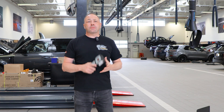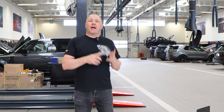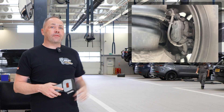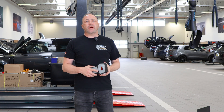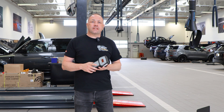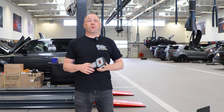So this is to test the park brake on electronic actuators on the calipers using the standard roller brake tester. This isn't for vehicles that have cables for the electronic park brake, even if they are electronically operated — so this, not this. You test the service brake using a decelerometer as usual. That part hasn't changed. However, now you don't use a decelerometer for the park brake. You can't use a gradient test either — I asked, they were rude, said no, we moved on.